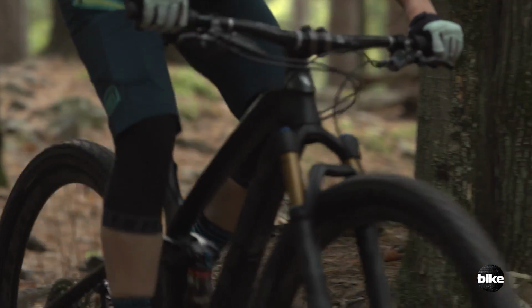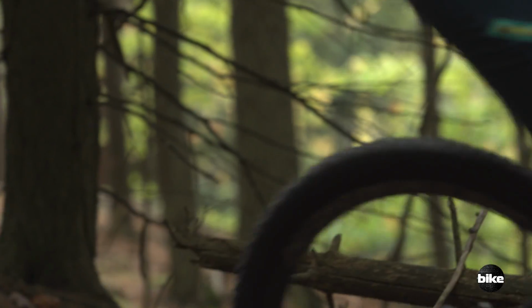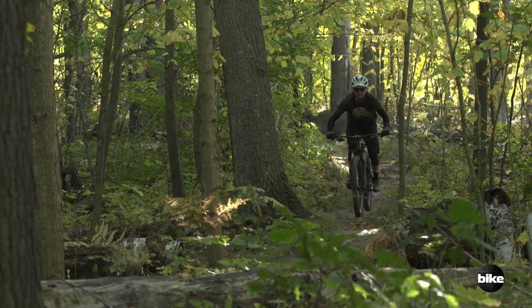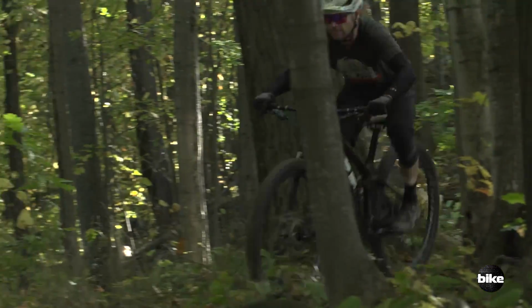You know, this bike's got 29-inch wheels. It's 130 travel front and rear, and over the different generations of Trek's ABP suspension, I always found that to work the best in their longer travel bikes in descending. I thought it was an incredible descender. However, when you were climbing, you pretty much always had to rely on a Pro Pedal lever or some sort of platform lever to keep it as efficient as possible.